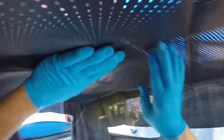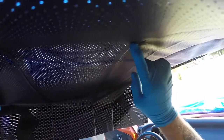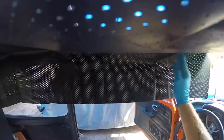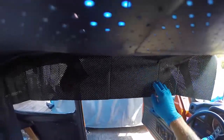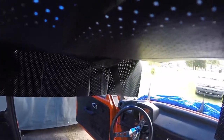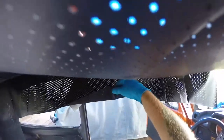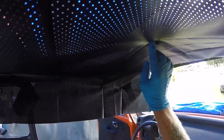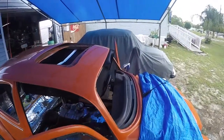I like where it's going to come to the sunroof — I want to tighten it up — but I don't like where this seam is getting so close. Remember, this is not the sunroof headliner. The sunroof one doesn't have the bow stitches, but it does have one seam across. Once I tighten it up and start working around, it's going to look fine. I just don't want this near the edge where I'm going to be fastening it to the sunroof. I'd like to bring it back a couple inches.